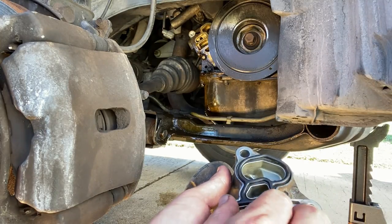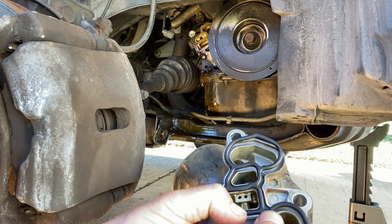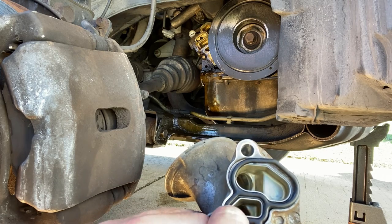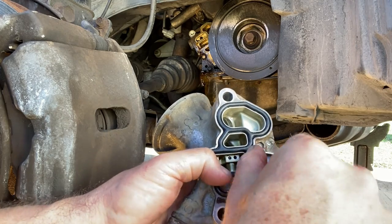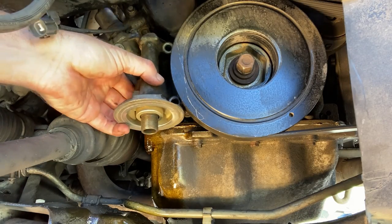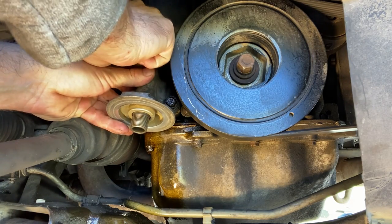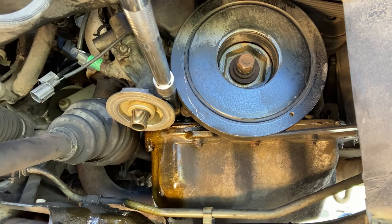With the part all cleaned up, it's on to installing the new gasket into the assembly. This integrated gasket and filter took a little bit of time to install, so I went slow and methodical, pushing each part into the groove on the assembly and making sure it was seated properly. I also made sure there was no debris anywhere before installing the assembly to the block. We then reinstall the assembly with the three bolts, hand tightening them first and then torquing them down one by one. The torque spec for this MDX was 16 pound-feet.